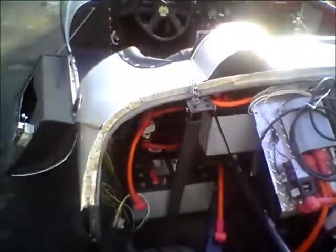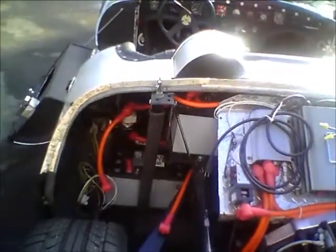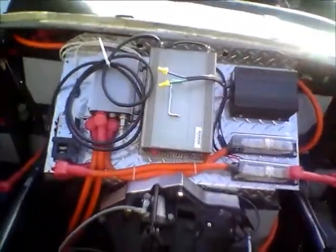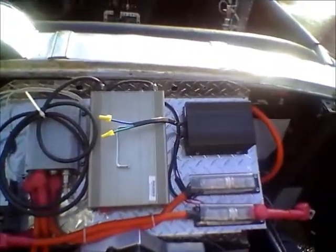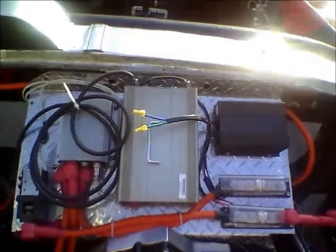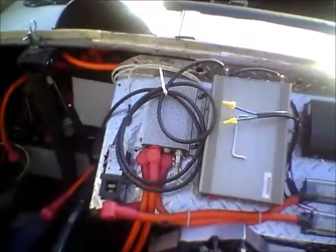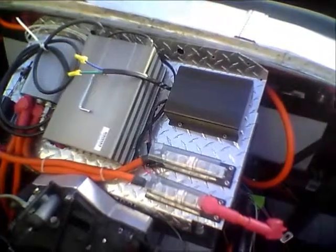What's cool about this car is it's a 96-volt DC system with eight batteries and an Advanced DC motor at about 26 horsepower. I had this panel constructed for the car: the large unit in the middle is the charger, the one next to it is the controller, and the rest are switches and solenoids — all built and wired underneath the panel, which is also a heat sink.